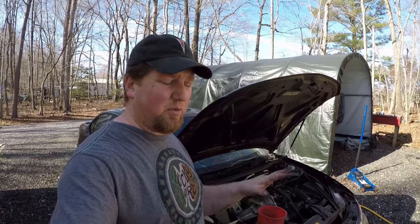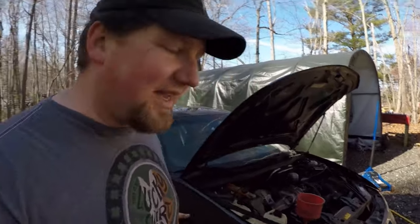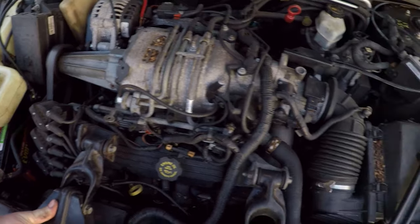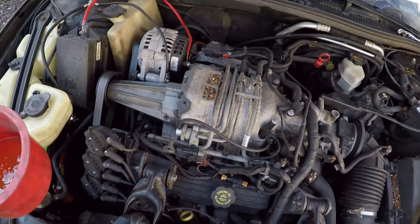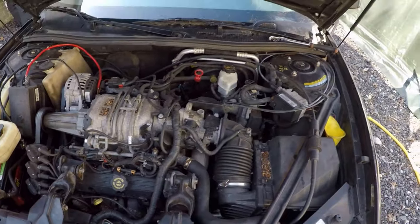So I had some visitors and I had to talk and work at the same time, so I didn't film this part, but this is not a tutorial anyway. This is just a vlog to show you guys what's going on. But as you can see, the 97 is back together. It has the 99's radiator in it, which fit just fine and is kind of an upgrade for this car anyway. I'm bleeding the air out of the cooling system right now, letting it warm up, and then this one will be done.